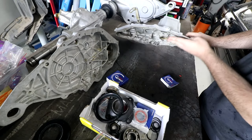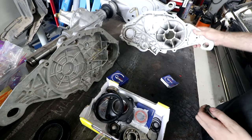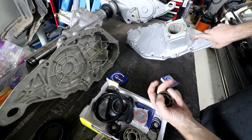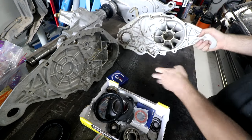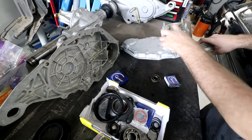This bit here is the wheel bearing. There's a bearing in the front here, and there's a bearing in the end. And when I pulled it apart, these end bearings had no shields on them, so that tells you that this is supposed to be full of oil, which you would assume. This being full of oil, the oil's also going down this hole into this bearing.